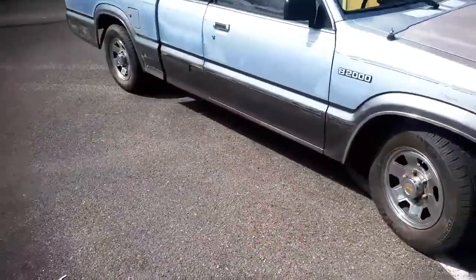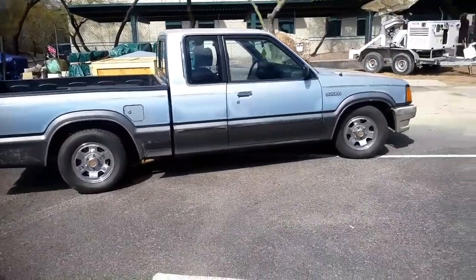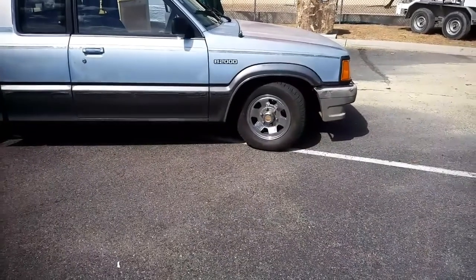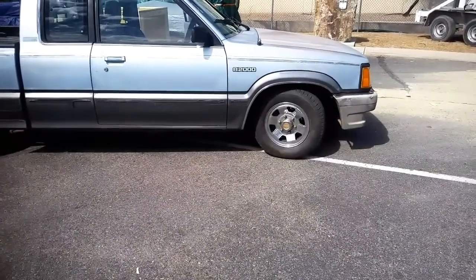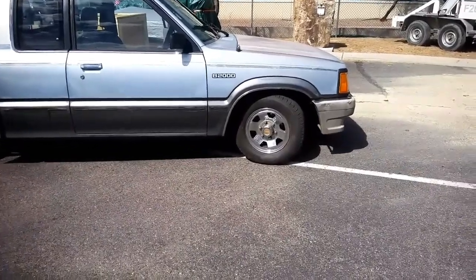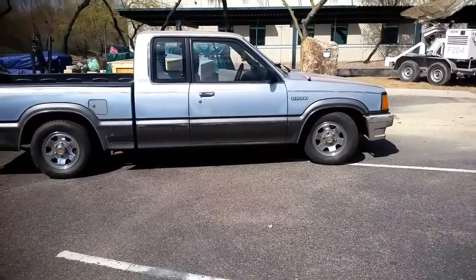Now with the hood closed, come on out over here, and you can see the rear has been dropped by 2 inches, just like I planned. The front, I'm honestly not sure how much of a drop that was. I actually just put it down on the wheels and started loosening the torsion bars until it got to a point where I liked it. You might recall I had loosened the torsion bars 5 full turns already. I went another 6 and it wasn't quite low enough, so I went another 2 and then realized I was sitting on the bump stops, so then I pulled the bump stops out, and I think it looks great. Maybe a little lower in the front than I had intended, but it looks excellent.